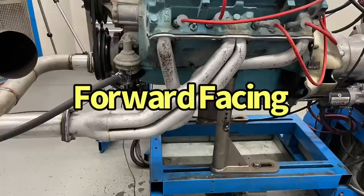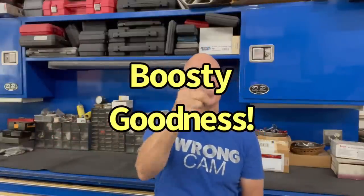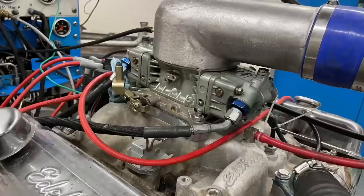But how long does it take to build the turbo kit? Richie, you only had like eight hours. Can you really build a turbo kit in eight hours? Yes. I reversed the headers on the Pontiac 350. I took the Y-pipe — you can see Super Richie style, it's not perfect, but it is done — and it did get all the exhaust into the turbo. Then I had to take the turbo and get all that good boosty goodness into the carburetor. So I took all the aluminum tubing I had laying around. One elbow even had a blow-off valve because we use this on a lot of Super Richie turbo kits. Get the discharge going from the turbo into the carburetor and you have a turbo kit.